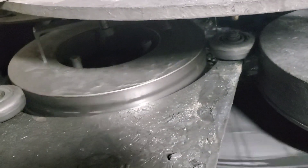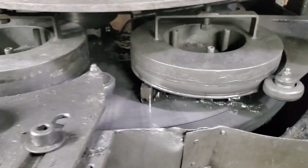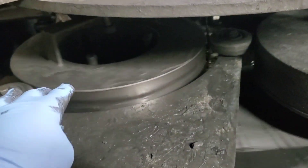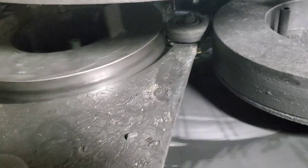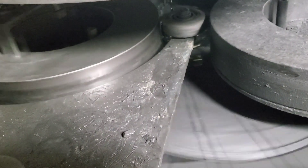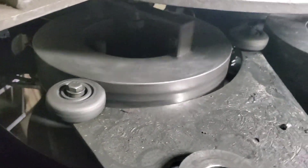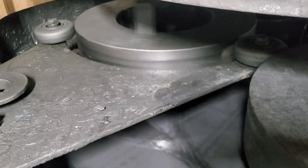We're underway. I can run four plates, but right now I'm only running two. I've got that RX-8 center plate that I just flashed a minute ago, and then we've got our 12A plate spinning around right here. We run a very fine polishing slurry, so I cut pretty slow. It can take probably way longer than a lot of other places — I can run a plate for a few hours and only get about a half thou off. But I really like the fine finish and I don't like going back and forth on slurries. Always make sure they're spinning, always make sure it's clean.